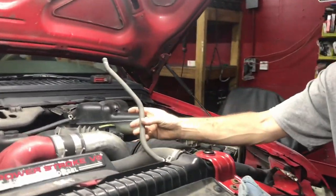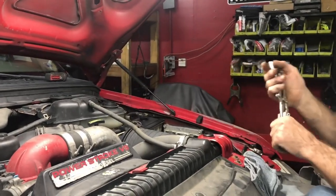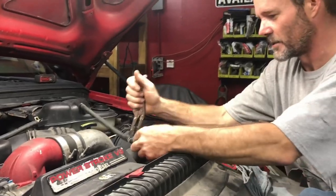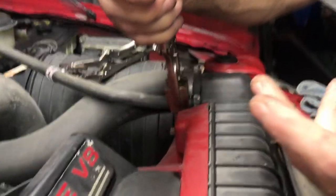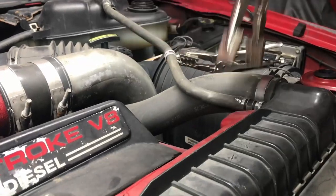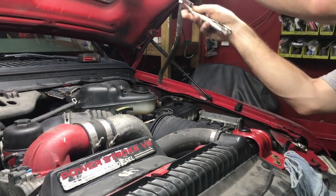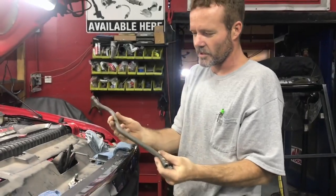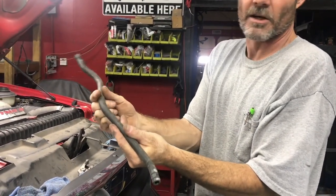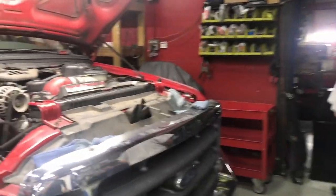Look — that's a new hose, it was a new hose back in 2017. So I'm not gonna damage it by putting the clamp further down. Now we'll go ahead and get these clamps off — just grab it a little bit and cock it sideways. There it goes. Normally you'll hear a crack when the hose pops loose of the radiator as the rubber comes loose of the plastic. Take these clamps off. If it's an old hose and it doesn't look good and there's witness marks, I'd just move the hose over and clamp it there. But when the hoses look good I don't want to put lines on them — I want to clean it up and make it look almost brand new again.